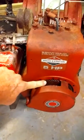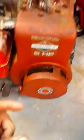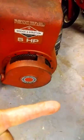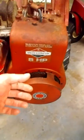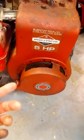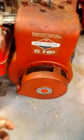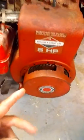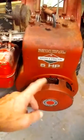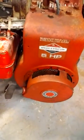And I cleaned the spring and then I put it back together in the housing. And then I took this, it's the clutch, is what that is up there. It's got a little thing that sticks out about like that. It's got four squares on it. And it's got a dust cap that goes on it. Well, inside that dust cap, there's six bearings. Okay, and that thing interlocks, you can look it up on YouTube, but it had gum in there, and the bearings had a little gummy in a rust spot. You can see where it was just sitting. This thing had sat outside, that's what it did. And it collected water on it, so.